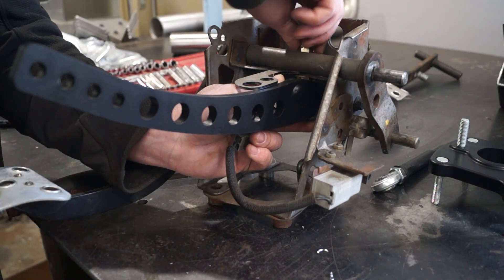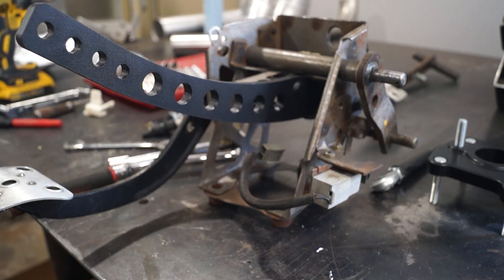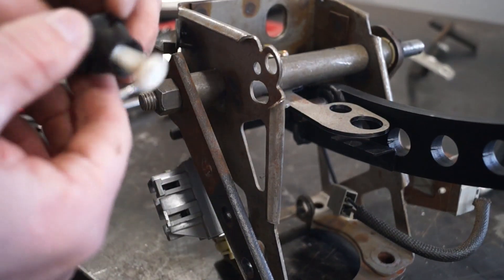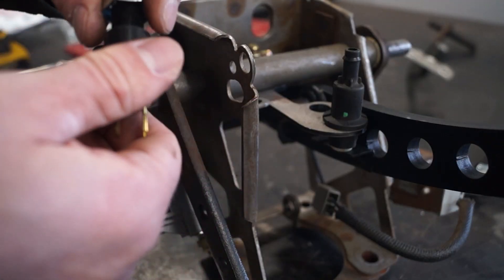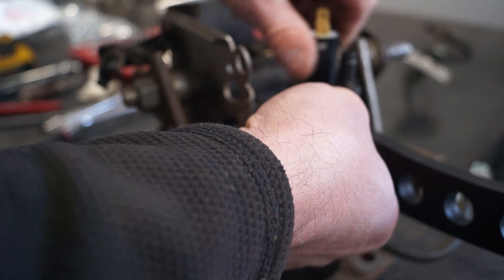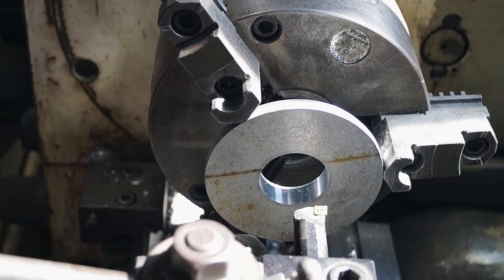Now we're installing the Maximum Motorsports bracket they supply for the updated brake switch assembly. I'd recommend installing that before you put the pedal in — I accidentally did it the other way around and it was a bear. The larger hole on the bottom goes to the cruise control interrupt, and the other hole goes to the new brake switch supplied by Maximum Motorsports. Once installed, make sure the pedal assembly has free motion and both switches close as they should. Some slight adjustments will have to be made after the pedal box is reinstalled.